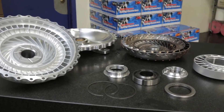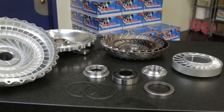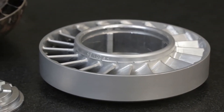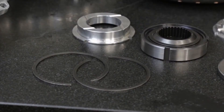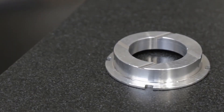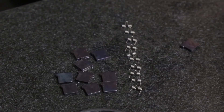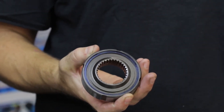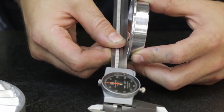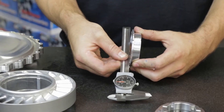The stator group is now fully disassembled. Now that everything's apart, it's a good time to inspect all the components for signs of wear or damage. Some of the things to look for when inspecting the stator assembly are the stator cap, the mechanical diode struts, springs, and spiral lock. It's time to replace these parts when you see deflection in the struts or the cap, when the springs are compressed, or when the spiral lock has excessive wear.